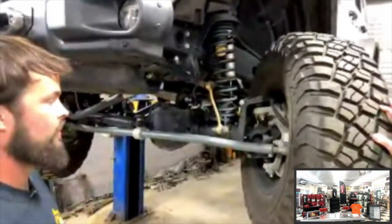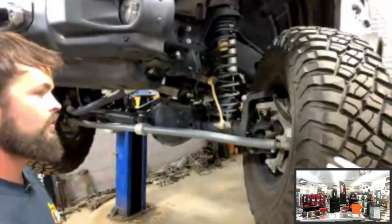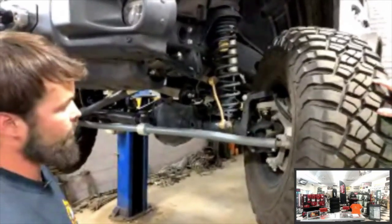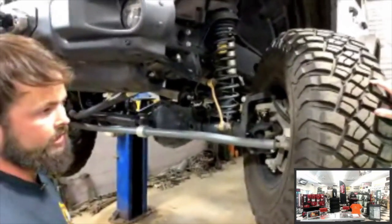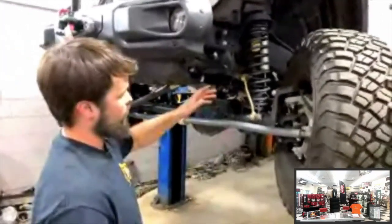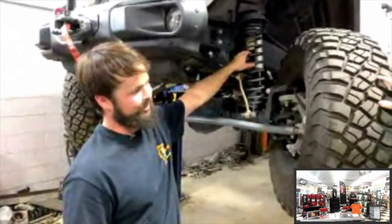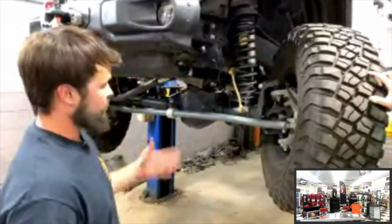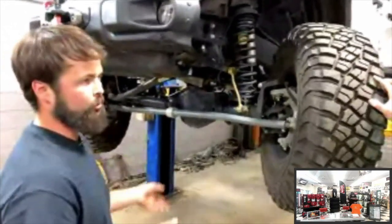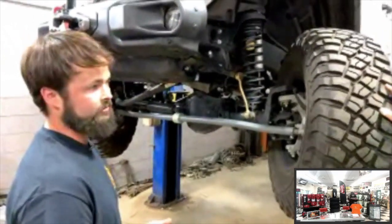You can also go with a traditional regular-wrap spring where the gaps are equal the whole way. Factory Jeep springs are essentially standard equal-gap coils. The aftermarket world is moving toward progressive and dual-rate springs because you can run a much longer shock and get more travel without the coil unseating. The newer JLs flex so well with stock geometry that they can handle more travel without immediately needing a long-arm kit.